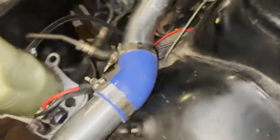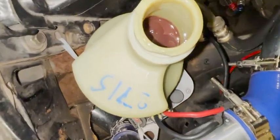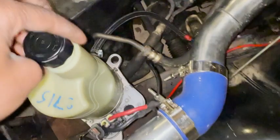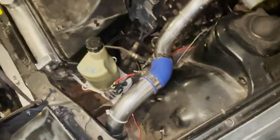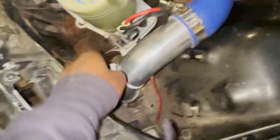It's leaking just a little bit. If we look at the fluid level, we haven't lost much fluid, although it's super milky — had so much crap in the system, it's horrific, so I might flush it again. I also have to clean up the wiring a little bit, and I've got to make proper mounts because it's held by zip ties right now on the intercooler pipe, which is horrendous, but it kept it in place somehow.